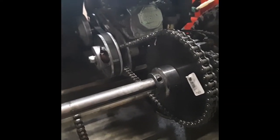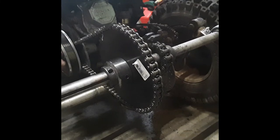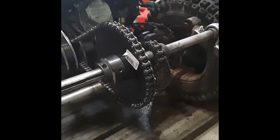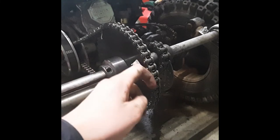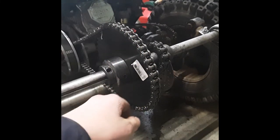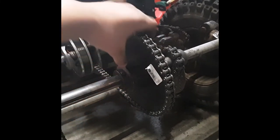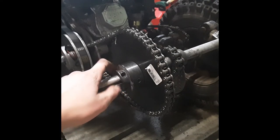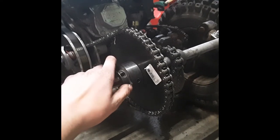We are now going to make sure that it looks alright. It's not too bad on the tension — I don't think this tension is too terrible. It's a little bit loose but that's okay for now. This chain will stretch and eventually I'll have to break it again and put an offset link in it. For sprockets, if you have it on an axle, you might want to invest in some collars. I got a pair of collars for $10 on eBay — they're split collars, they're real nice. Split collars are usually better than ordinary collars because you can put them on without having to pull your axle apart.